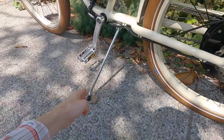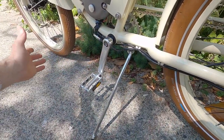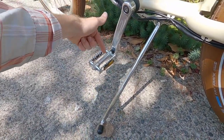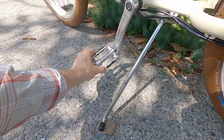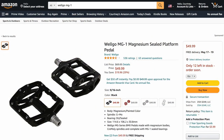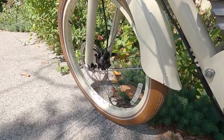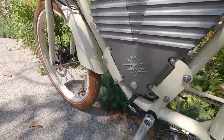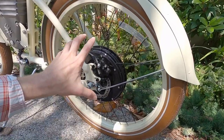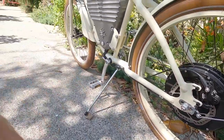I flipped the bike around so you can see the kickstand a little bit better. I want to talk about these cranks — these are forged aluminum alloy, 170 millimeters, which is very standard. Then we've got these vintage style pedals here; they do offer good traction and you could press snow and mud through them because they're open like that. But they're not as big as some of the newer pedals from Welgo — they have a BMX pedal or even a magnesium pedal in different colors, silver or black, if you want a bigger surface area. I want to call out the 14 gauge spokes up front — black, they look really nice — and 12 gauge spokes in the rear. These extra thick spokes give you strength for all the power running through this system. And even the rims are a little bit wider to support these high volume tires.